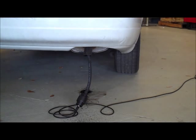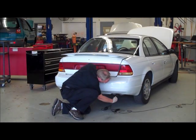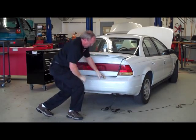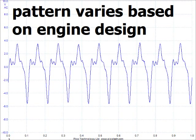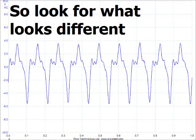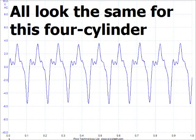Once the sensor is in place, I'll do as I did in the earlier test: crank the engine and capture my scope pattern. With this tool, though, I'll use the AC voltage function on my scope. You may need to choose AC coupling on yours to get a good pattern. This pattern was captured from a Ford Focus and is typical for a four-cylinder engine. As with many scope patterns, this one will vary between differing engine designs and cylinder counts. Don't focus on the trees, but look at the forest — look for what stands out as different. If one peak were lower than the others I'd wonder why, but as these are all uniform, it's a good bet the engine is sealing just fine.